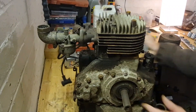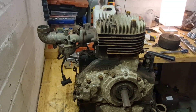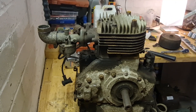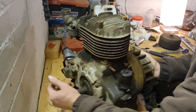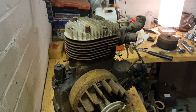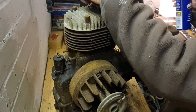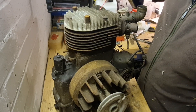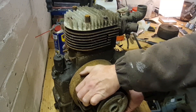Let's give it a little spin around. We have to excuse the air compressor. That engine's still very tight. Do you think I should do my old WD-40 down the plug hole trick? The piston's over here, the valves are going to be here, so we need to put our straw in. We've injected a bit of WD in there - let's give it a turn. It's tight.